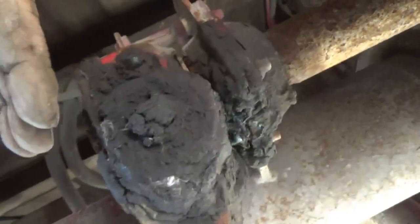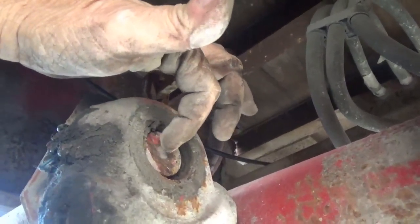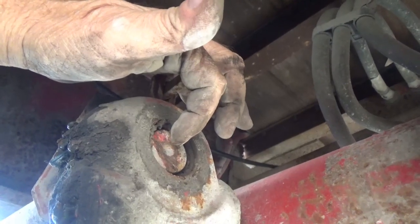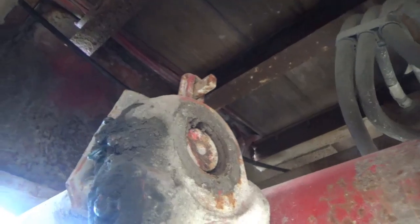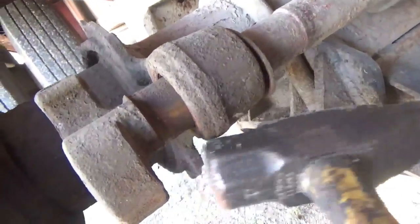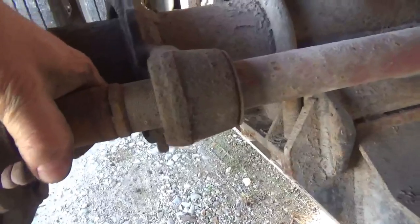Getting looser. I might not have room to swing a hammer because the other one's right there, but it's got a hole in the center — a centering hole from when it was in a lathe being cut. I can use that to catch the corner of a socket extension or a long pointed punch and try to hammer it out. If it keeps moving, fine; if not, I may have to use a slide hammer. I'm making progress just hitting it right here.